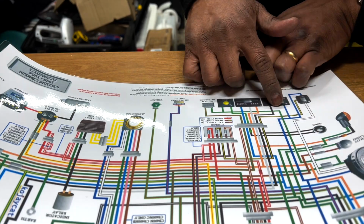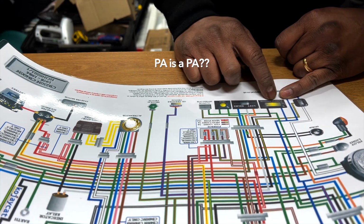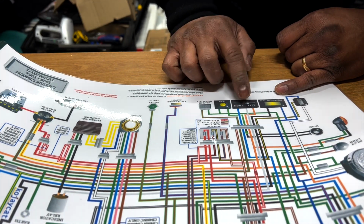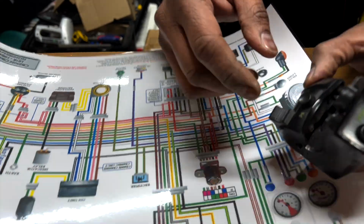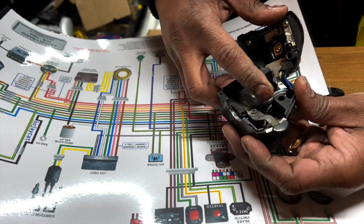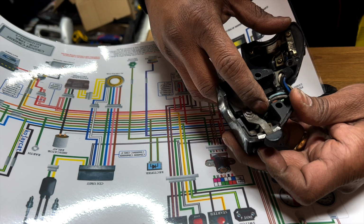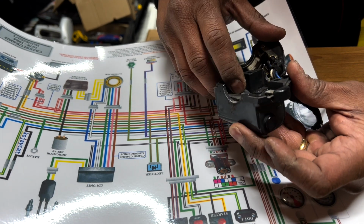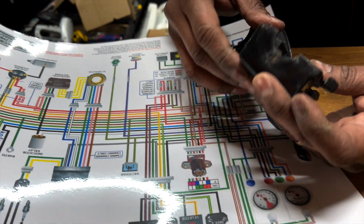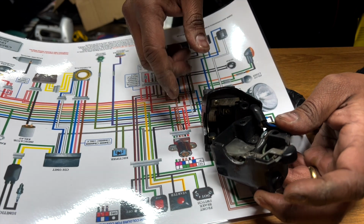And then here you can probably follow me. If you see here, all these connections: high, low, passing switch. So that PA button that I didn't know what it was is a PA, and then there's a left and right. This is obviously the indicators and the horn. So we have 1, 2, 3, 4 controllers, and these are the 1, 2, 3, 4 controllers in here. So I've opened this up just to see where they go. You can see that the horn goes all the way at the bottom for the green, light green and dark green, and then you have a few going at the top, which is the light blue, orange. I think this is the gray, going to the indicators, and it looks like it makes sense from here.